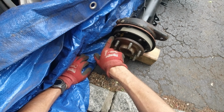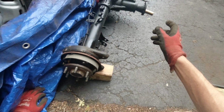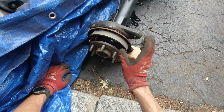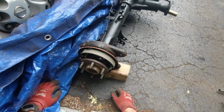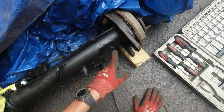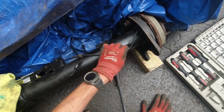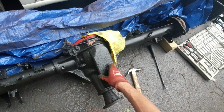I'm maybe gonna be fighting with this, putting the emergency brake inside there, but maybe since I released that bolt inside, it should be easier. Then I have to just adjust these pads so they just touch the rotors, and the rest should be good. Now another thing, over here on this side and this side, I had to chop this off because otherwise it's gonna interfere with the plate that we're gonna have on top. But this is no big deal, this was just for this cable, we can always just zip tie it. But yeah, now we can start putting the new axle in.